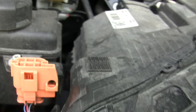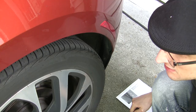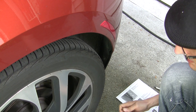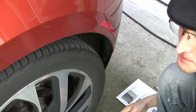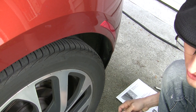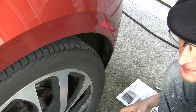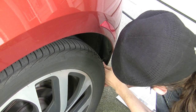If you want to be fancy about it, you could put something in this hole, like a lock, so it can't accidentally fall down. The battery juice doesn't actually go through that tiny little connector — it just controls whether the main battery contactor or relay has the potential to be energized. In the car, there's a huge relay that engages or disengages when power is required. When you turn the car on you hear a big clunk, and when you turn it off, another clunk. When sitting still, there's a chance the smaller lead acid accessory battery could run low and engage the main contactor to top it up from the big traction batteries. Definitely don't want that to surprise you. So, 8mm bolt.